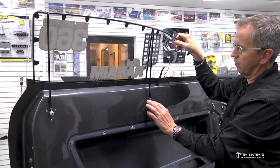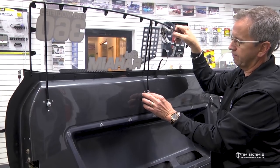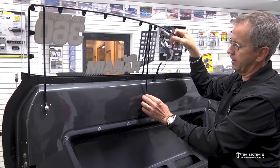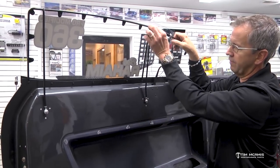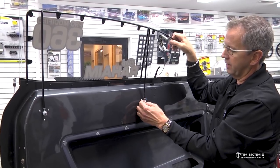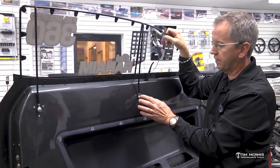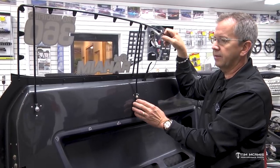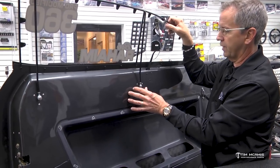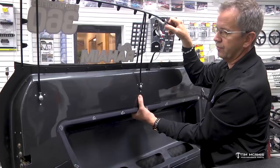If you're not going to use the rod end, this will get welded down here to a plate that bolts on and it'll be a set adjustment. So you want to do that last so you can have it tacked up here and fasten it to the plate down here. What we would do then is at the end of this tube, we'd bend it in a little bit — put a little bend in the bottom of it, cut it off flat, and weld it to that plate. There's also a plate on the inside so we want to sandwich that, because these doors aren't real thick. This is a real light carbon door so it doesn't have a lot of material right here.